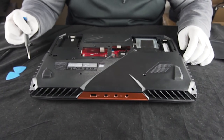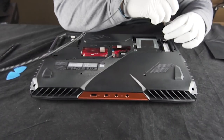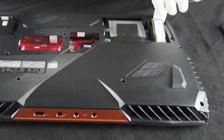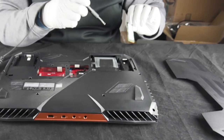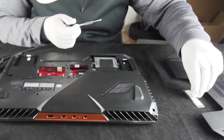You should start by removing everything that's in here, and then we're going to remove all the screws. So we'll start over here with this NVMe — take out the screw, it pops up at a 30 degree angle. Done and done. Keep everything together.